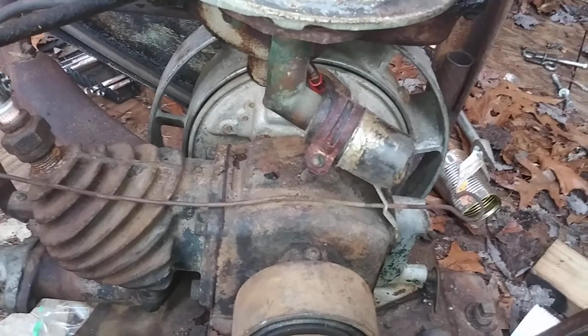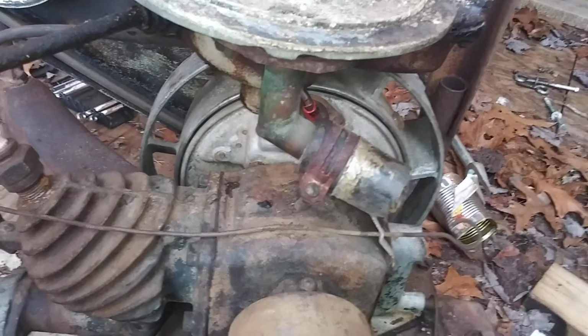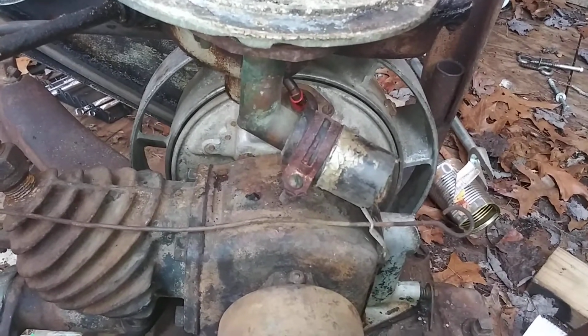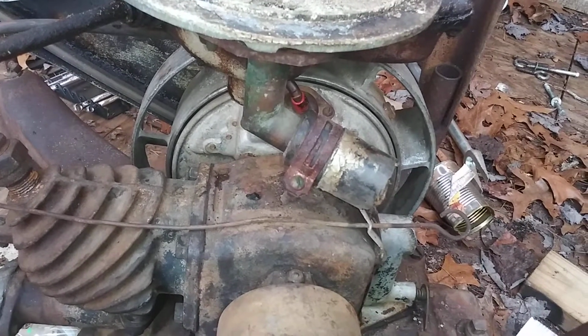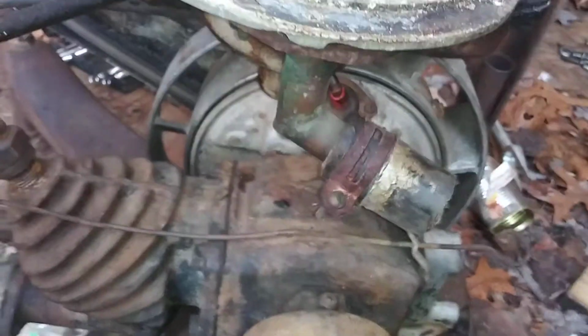And you can just take some steel wool if you really want and just kind of rub around it and make sure it's not cracked or anything. Or you could just tape the end up, hold your hand over it, and take a bottle of water and pour down it and see if it seeps anywhere.